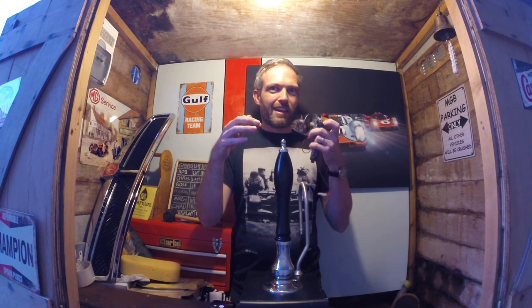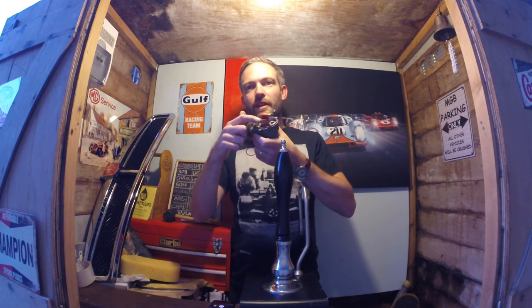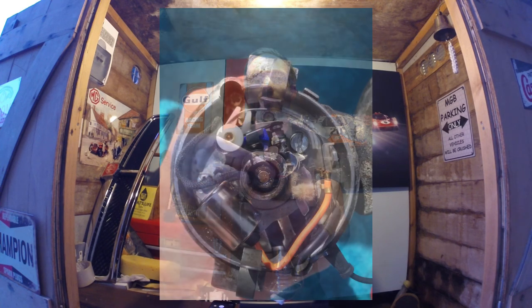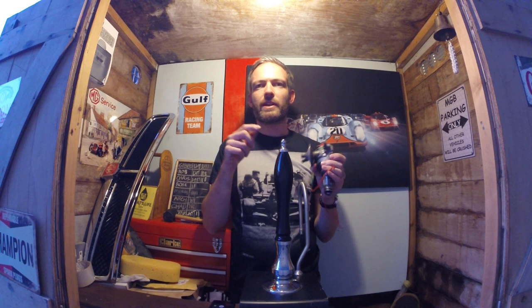So let's have a look inside — there goes the cap. When I turn this shaft you can see the rotor spinning around, and that would get near the points inside the rotor cap and distribute the spark. What's different about this particular one is this big red block here. Normally on this base plate you'd see some points and a condenser, but what I've done is fitted a very cheap electronic ignition module.